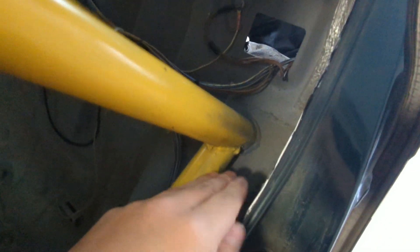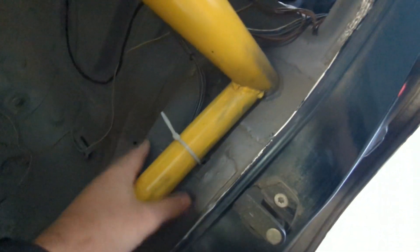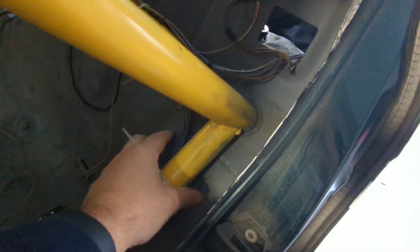Back to the rear of the cage — this is an example of a mounting plate as opposed to a plinth, and you can see it's just flat on the floor of the car. This is actually touching part of the wheel well, which is not a good design. Ideally you want it to land somewhere that won't crumple as easily as a wheel well, since it's not structural. However, on a sedan your options are somewhat limited. Note that this down tube is uninterrupted — it goes and touches the chassis with nothing bisecting it.